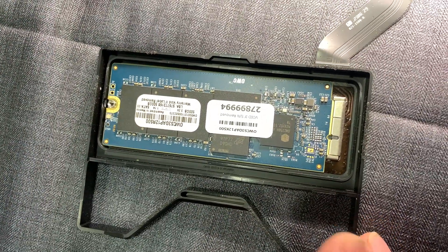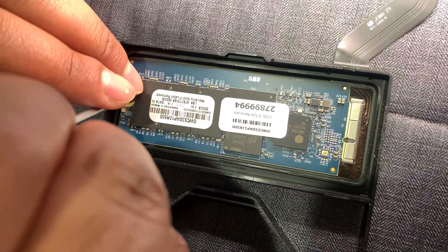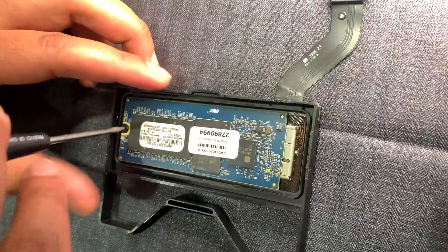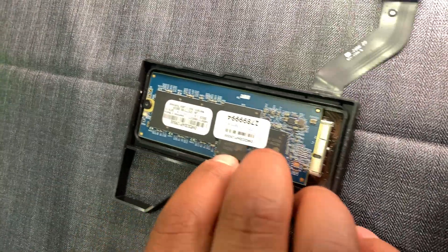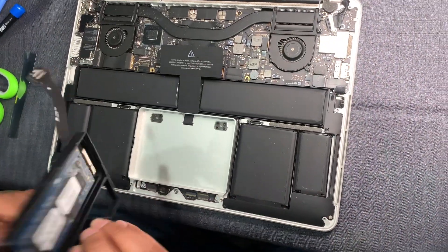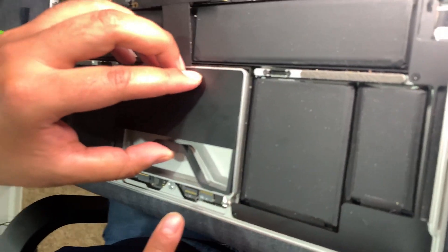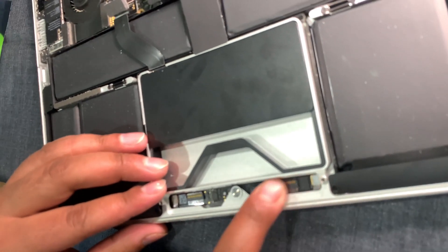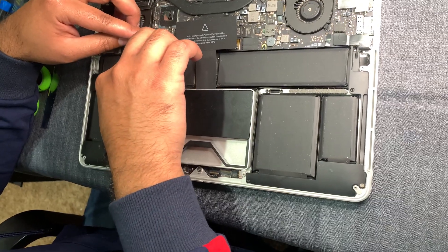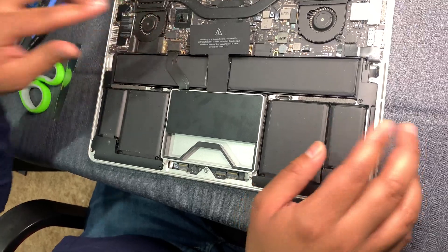You're going to push the Aura SSD into the port. Give it a little tug - it aligns with the notch. There is no wrong way to do this; if you flip it upside down it's not going to go in anyway. Then you're going to put the screw in to secure this SSD in place. Now we're going to bring the board over and flip it - we'll tug it in the drive side first, then push gently and align with the two notches for this to fully go in.